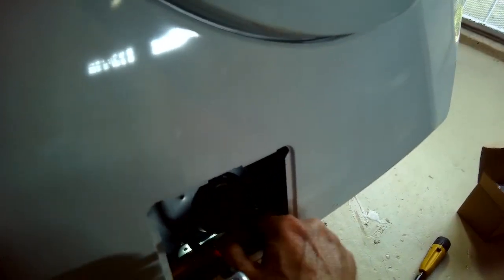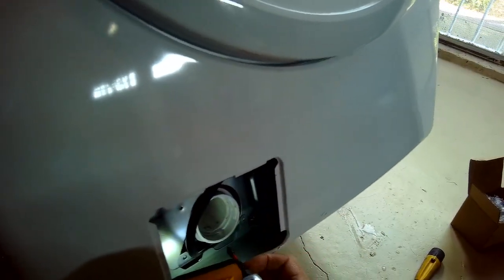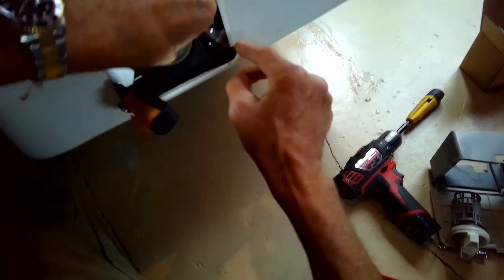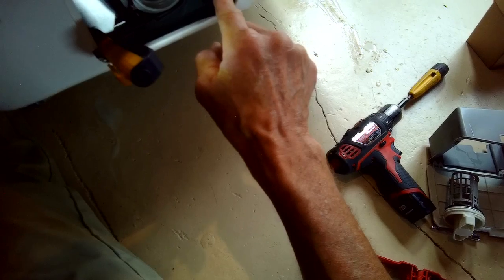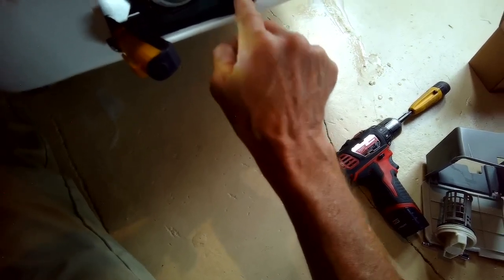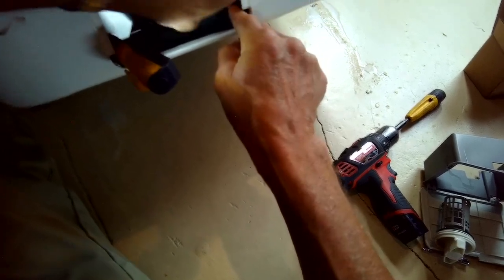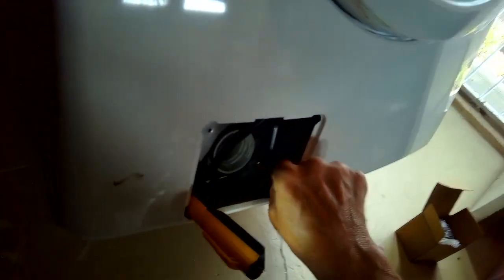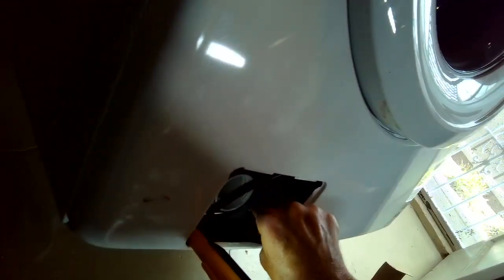And it is still connected by 2 hoses, or actually 3 hoses, and 2 power wires. So we have to disconnect some of those to get the pump into a position where we can change the pump motor. So we don't have to really remove the whole housing. Once we get that screw out and push it back, what I'm going to do is reach in and remove the power wires coming to the pump.